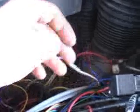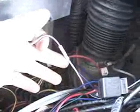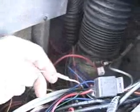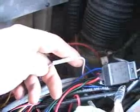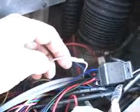This particular bus has an air door with a switch that is not activated by mechanical position of the service door. It's actually activated by the switch on the dash. So we need to install the optional ADK1 system in this bus. So the violet wire gets an extension wire attached to it. This extension wire runs over to the header above the service door.